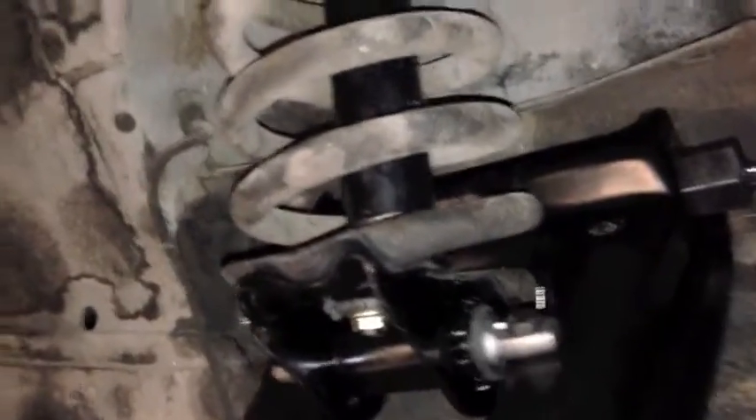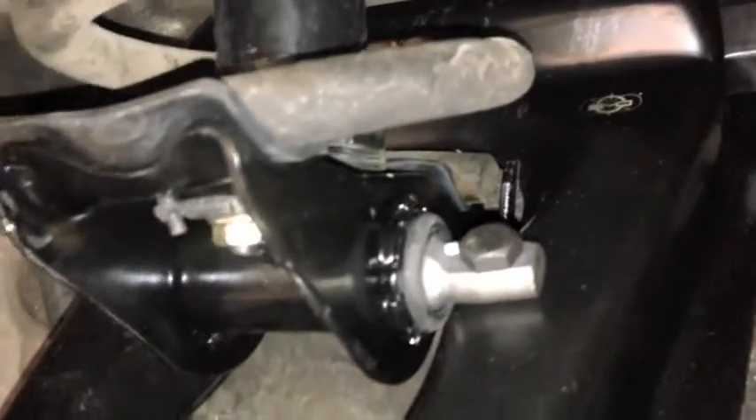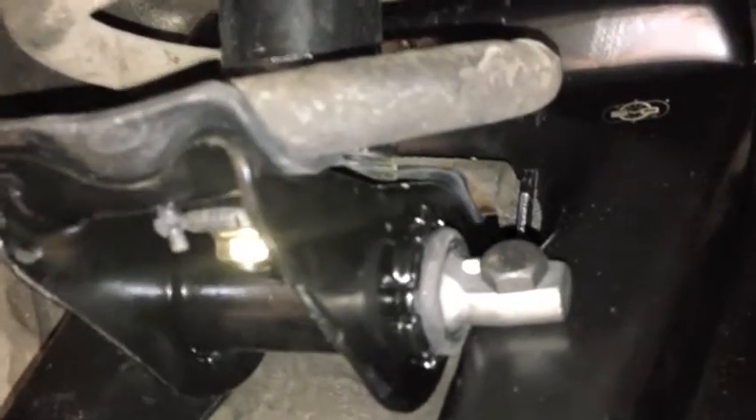So here we go, guys. Good job, Sky. Good job, Carlos. Springs are all seated nice. That's the correct position for your spring inside your spring perch. Notice the back spring fits into that little raised piece of metal in the back of your perch.